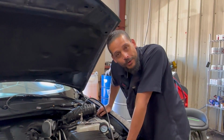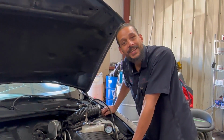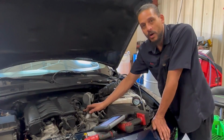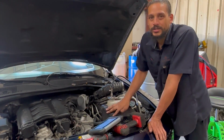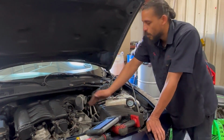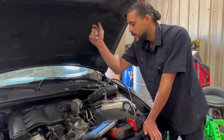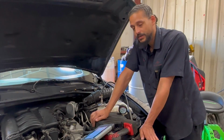If you fast forward around, you should have watched the whole video, but hey, I'm gonna say it again. These coils are cheap and it doesn't make sense to replace just one coil, because as soon as I send them down the road, another coil is just gonna fall flat on its face. I guarantee you. This coil was probably bad out of the box. So not one coil, all 6 coils and a radiator. Let's go talk to the customer and see what he says.